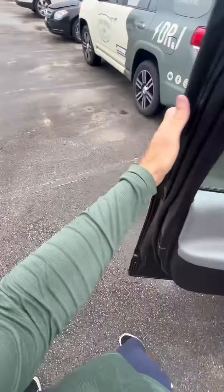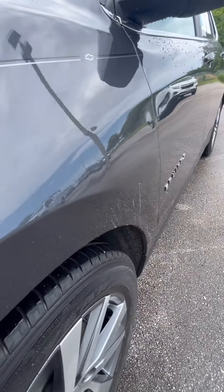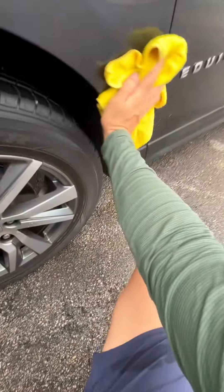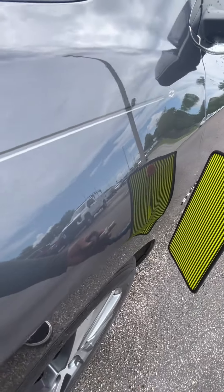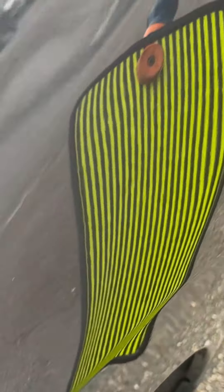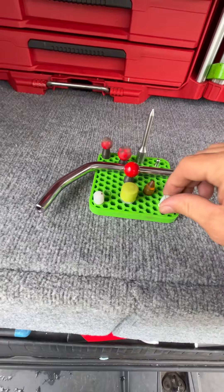I'm pulling this sucker up and, as you can see right here, we've got a nice dent above the body line with some smile on the backside of it. I'm going to clean it up with this detailer from Meguiar's so that we don't scratch the paint as we're repairing it and we don't want to damage our knockdowns. I'm going to use a line board today — you can see these lines should be uniform and straight, but where there is a dent, the lines are distorted outward, and whenever it is high, they are bunched up together.